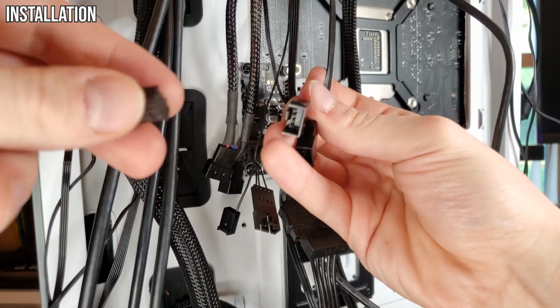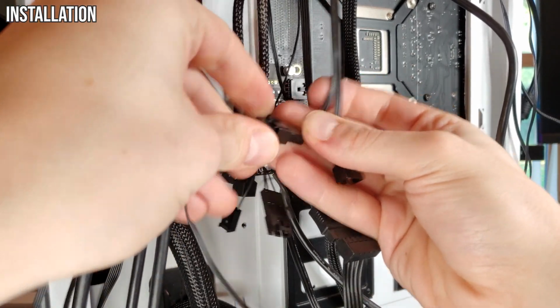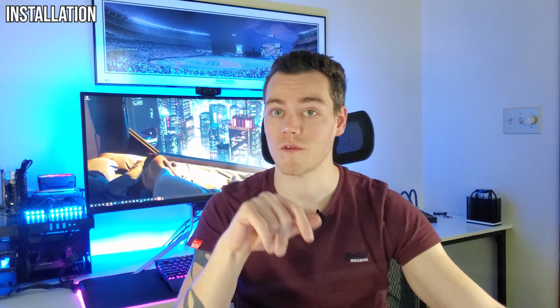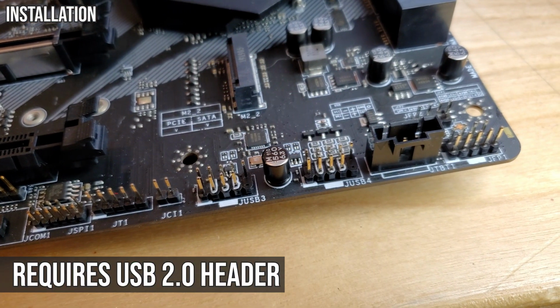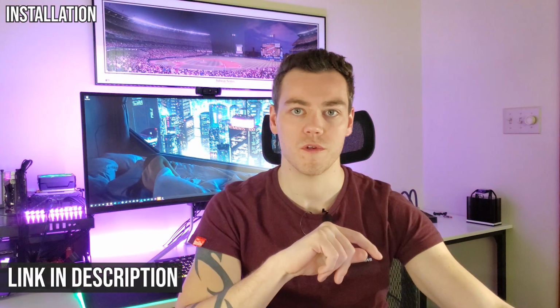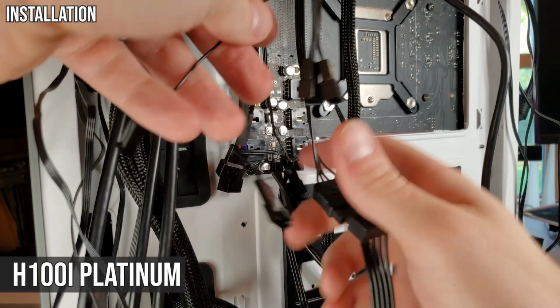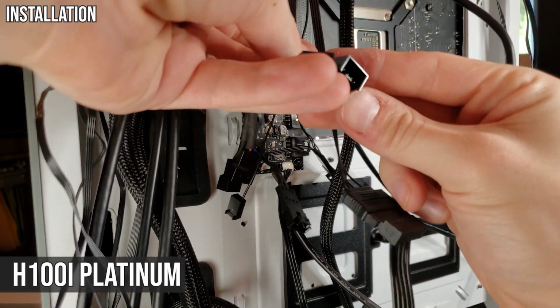But in terms of connecting it all together, they're both pretty simple, to be honest. However, there are a couple key differences between them and important points that you should probably be aware of. The H100i Platinum requires an internal USB header, so make sure that you have one of those free, but I'll link a couple cool devices in the description if you need an extra one. Otherwise, it's just a case of plug in the power and everything else where labelled coming off the pump block.